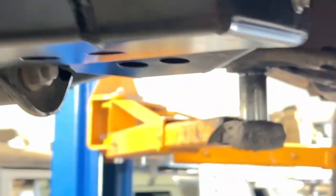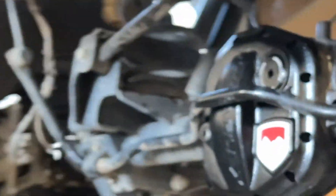The whole front end is done and put back together. Got to do a little cleaning. I've had this skid plate sitting around — I don't even know who made it, I bought it used about a year ago, so I finally put that on. We've got the Teraflex diff cover on, she's all filled up, everything's tight and torqued down. Just got to break in the gears — drain the oil in 500 miles, or if I can get 500 miles on before we go to Moab next week, probably not, but everything's all done.